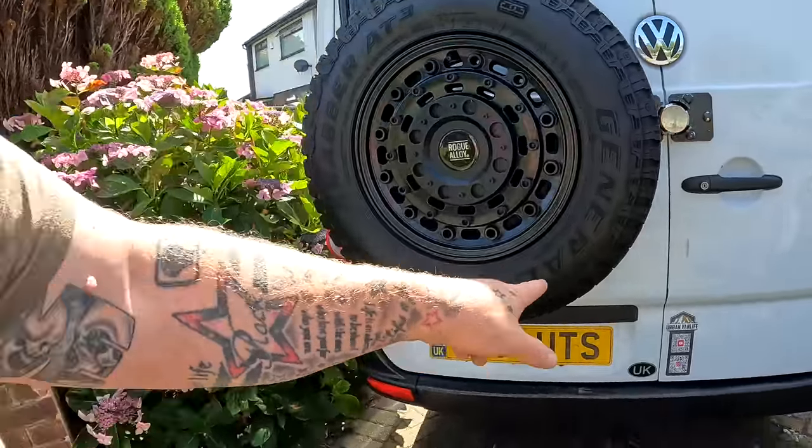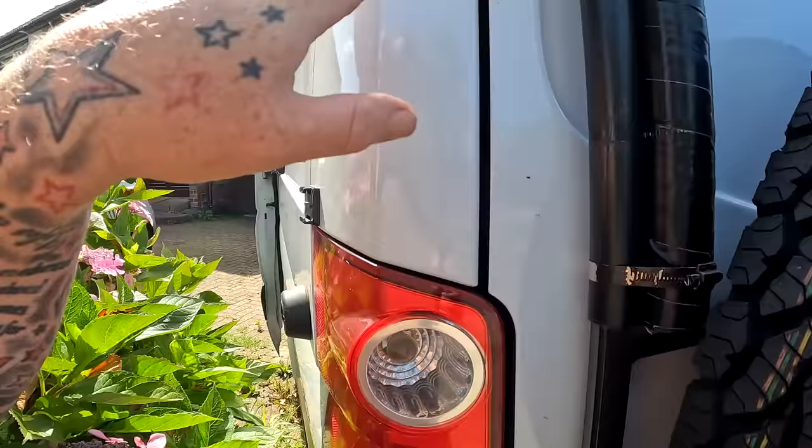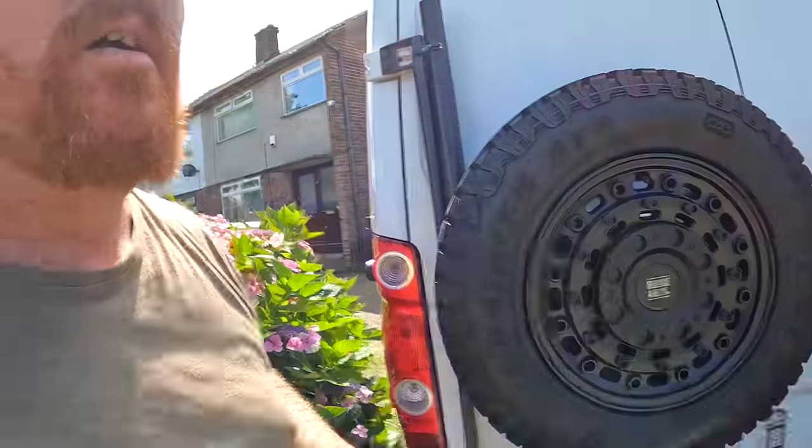We've now got to mount that one onto the rear of the van. Mounting this one on the rear is going to be a bit of a nightmare. Part of me is saying just don't bother, just leave it at the front. But I'm kind of invested now. The cable has got to mount inside the door, come through the actual rubber of the door, go into the van, come down, go all the way along the van, and then connect to the unit. Not really a massive problem, but I've only got three metres of cable to do it with, so I'm going to have to extend the cable.